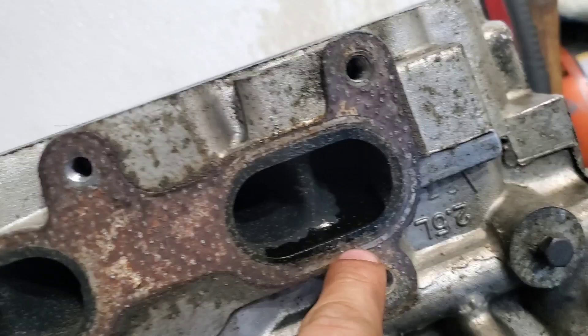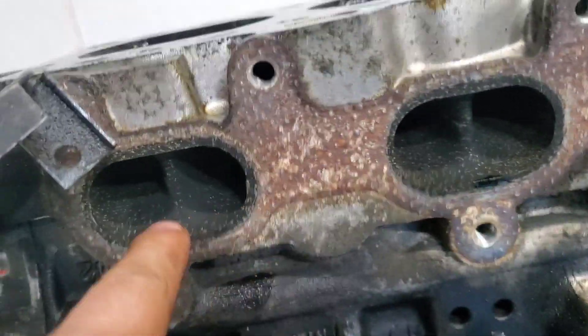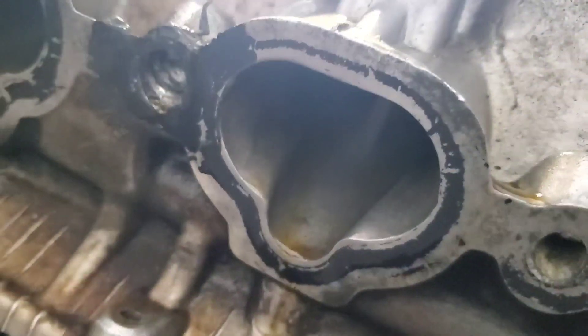I just added PB Blaster and I'm gonna see if it leaks or anything through the valves. This one is leaking a little bit — these two valves are from the exhaust side. About the intake side, I'm not sure if this one's leaking right here. This one is probably fine, and that one was leaking, so I'm just gonna let it sit for a minute.